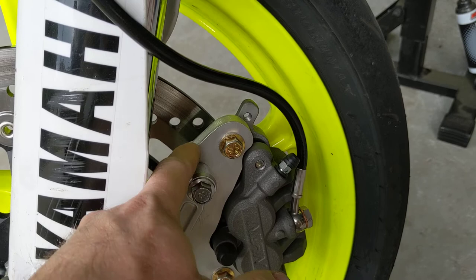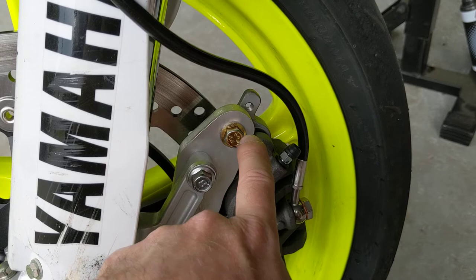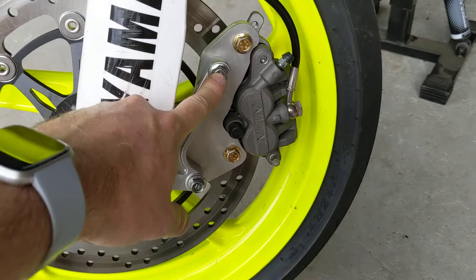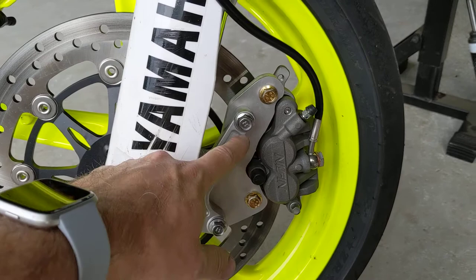That 12mm offset means I've been able to use a 12mm block of aluminium. The hole is drilled and tapped with a Helicoil for M8 thread, so the M8 bolt can bolt straight into that thread without any nuts on the back. This bolt then bolts directly into the caliper, exactly as it does in its standard position. The bracket offsets the caliper not just back but back and up, which means the brake line doesn't need to be extended, and to convert back to dirt I just remove this bracket and the caliper bolts back into its original place.